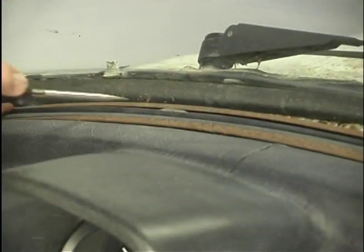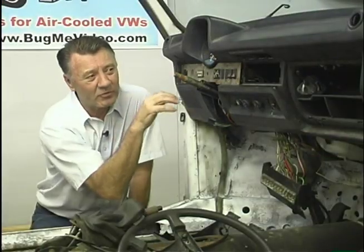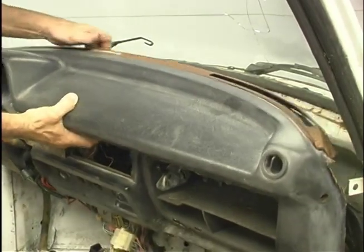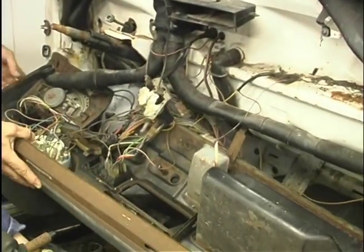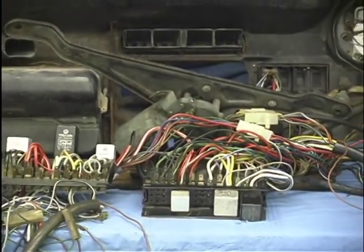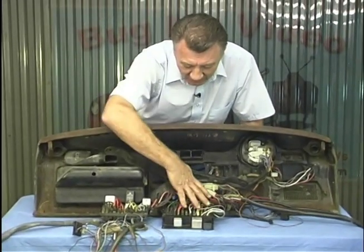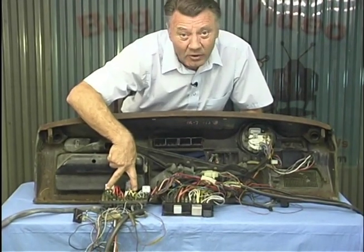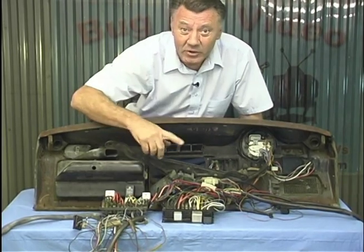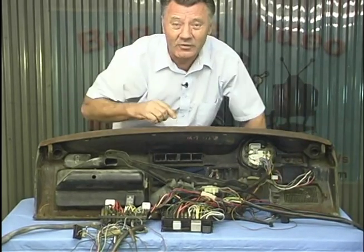You might have to push the vents down — they clip in at the back edge by the windshield. Then you should be able to grab the dashboard and pull it straight back; the whole dashboard should lean right back out towards you. With the dashboard out of the car and looking at the back of it, all these wires together can look pretty scary, but actually this mess of wires is just a continuation of the wires we were looking at on the fuse block earlier. We'll go through the different ends of the loom and start identifying the wires — it's not nearly as mysterious as it looks.